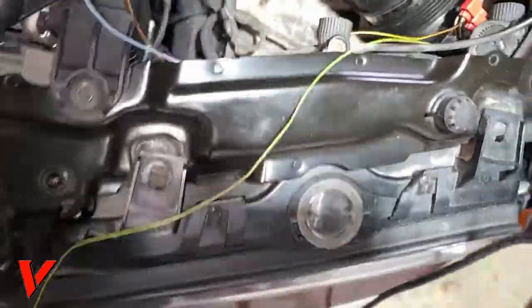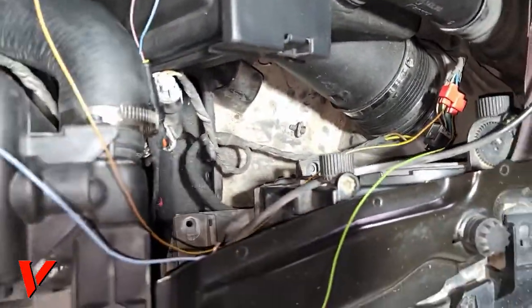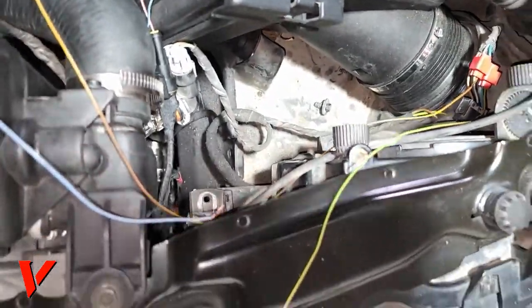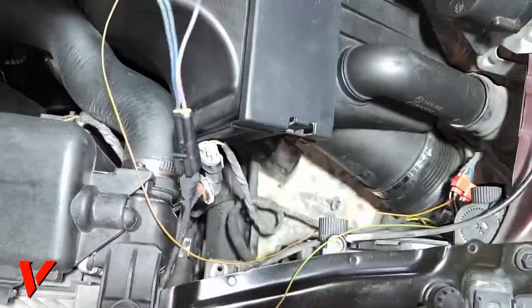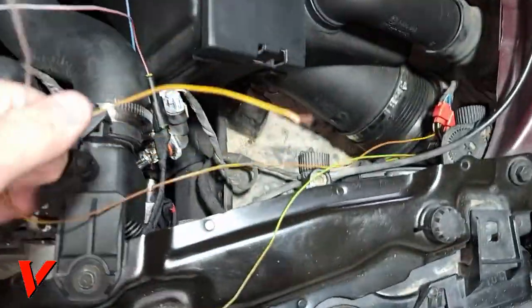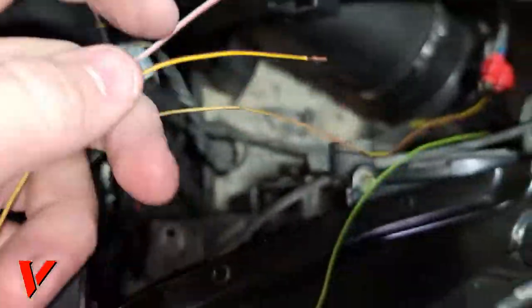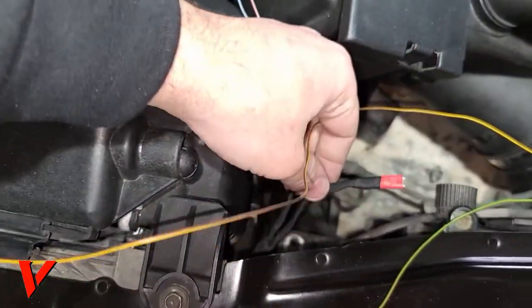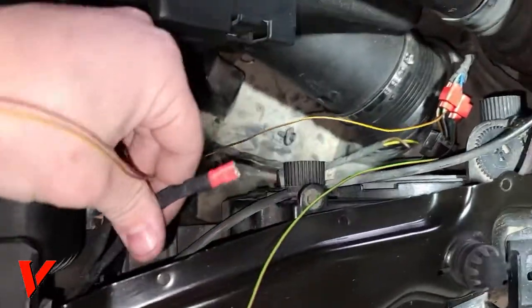Okay guys, I got the light in. It's not fully in. I will take it out again before it's completely installed. But I want to show you what I'm doing next. I gotta cut the wires to the right lengths, so I gotta figure those lengths out. Here's my positive. My positive will connect to the daytime running light. That is how I decided to hook it up. And my blinker light will connect to my third yellow wire connector right here. Very simple, very easy. I will go ahead and do that right now.